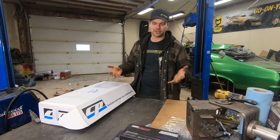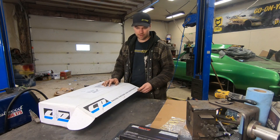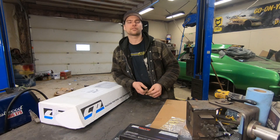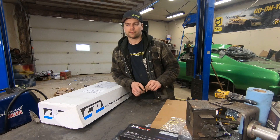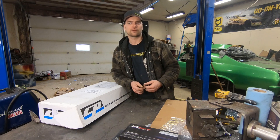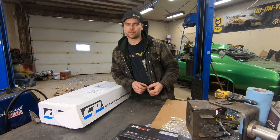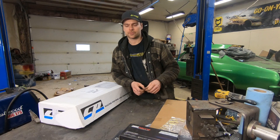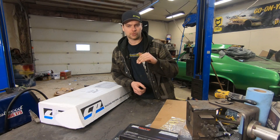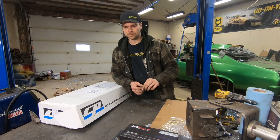If somebody calls you, just treat them right and they're a customer for life. We went with CP Carrillo this year. Last year I needed two pistons because we had a timing mishap where the timing didn't pull out, and I went down the track with only 10 degrees of timing pulled on a 400 shot where we were normally pulling a lot more. That rattled some stuff, burnt some spark plug tips off, and two pistons got right by the intake valve relief, rolled over and cracked.